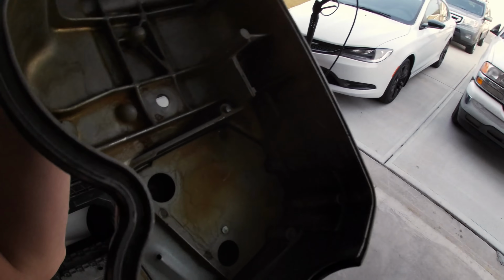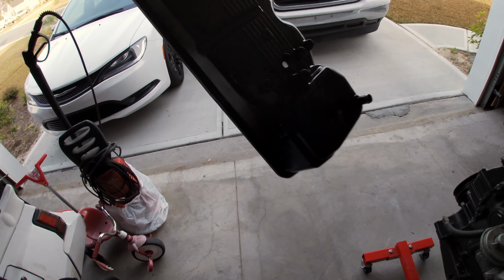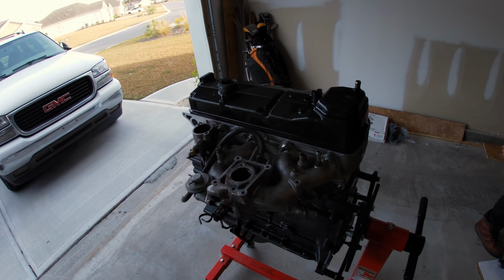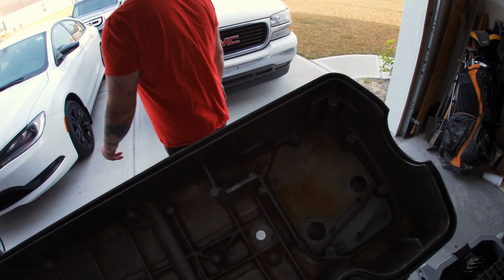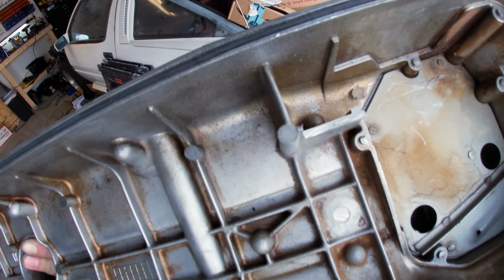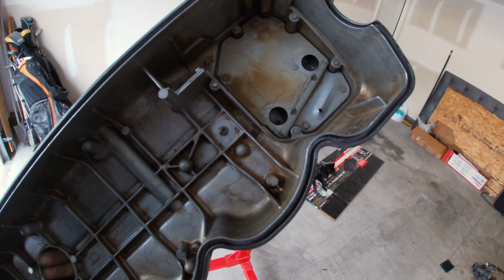Having fun cleaning? So I cut out a little notch there. And I'm going to have to repaint the valve cover and everything again. But it fits on there perfectly now. So yeah. If you're using ARP head studs, don't. Just use the factory head bolts so you don't have to modify. I'm just kidding. If you're using the studs, I had to cut that right there. And then there's a back baffle that I took out. And yeah, it works pretty good now.